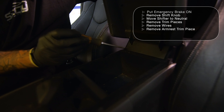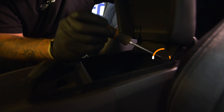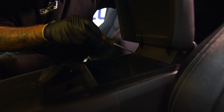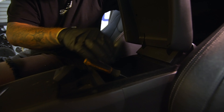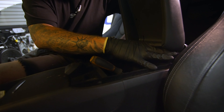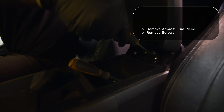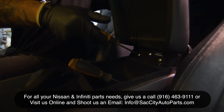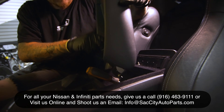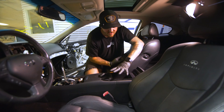There's going to be two openings — you're not going to be able to see it on the camera, but directly under the hinge there's going to be a little square there, and there's going to be a little square there. Put your flat head in there and just twist, and that will pop this plate out. Then you've got three Phillips heads. Just like that, you're able to remove your armrest.